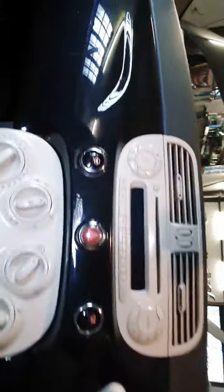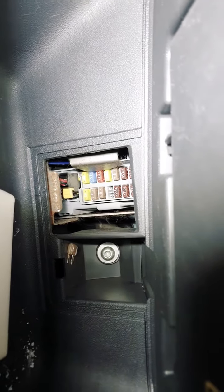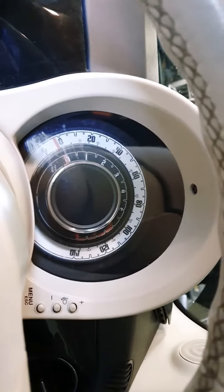So I did a quick check on the wiring for the fuses. The fuse was blown - right there, as you can see, the fourth from the bottom on the right, the five-amp fuse. I changed the fuse and it worked right away, but a minute after it went off again, so something was blowing the fuse.